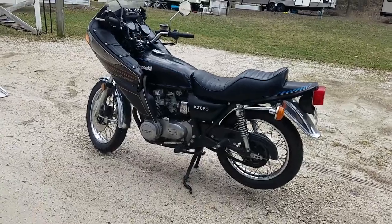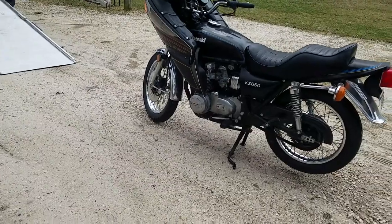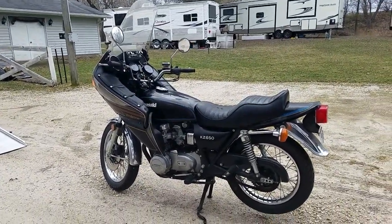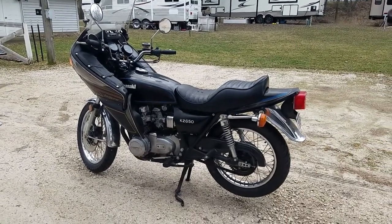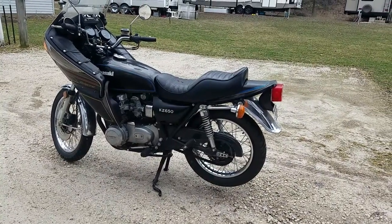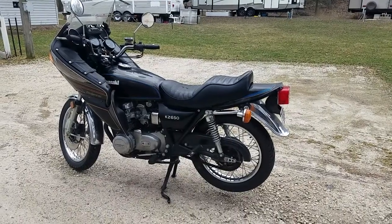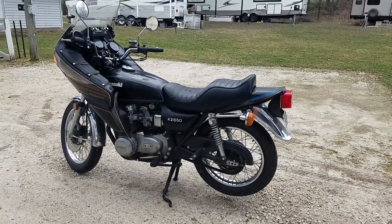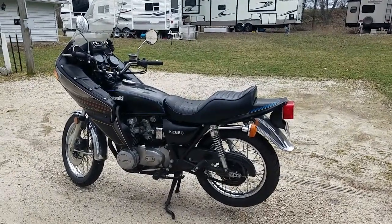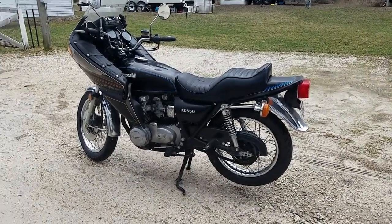All right, awesome. Now, one time I did have a bike, and it might have been a Honda, but the plug started to foul up. Is there anything that would cause that, or anything to do that would stop that? Typically, that's a rich running condition or an oil consumption issue. I'm guessing it was probably a rich running condition. I see. Okay. Or if the points and condenser were a little bit out of spec, that could certainly do it as well. So you shouldn't have that problem with this. We put that electronic ignition on. You'll never have to worry about any points or condensers again. Oh, great. Thank you very much, Ryan.